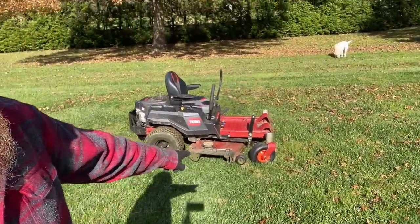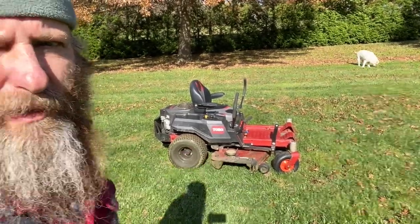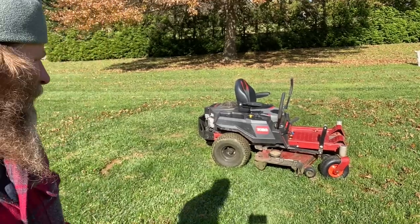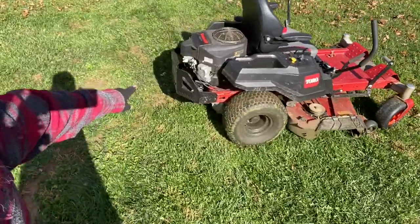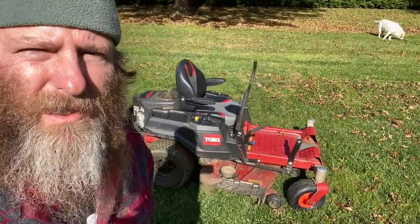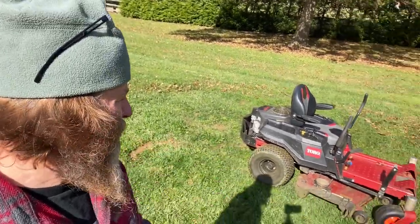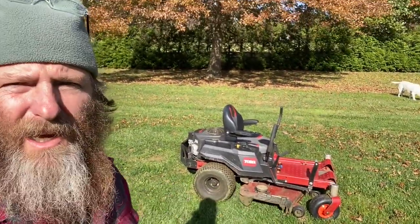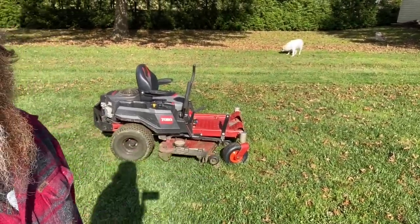This is the video — the Bad Boy 11 by 6 solid flat-free tires on the Toro Time Cutter 50 inch with the Kawasaki engine. These Kawasaki engines are great — you've seen in my other videos, I can cut farm grass in the pastures almost waist high with these things. Just know that you're going to have to drill your holes in the front to five-eighths and get a new five-eighths inch bolt, and you're good to go. Thanks for watching.